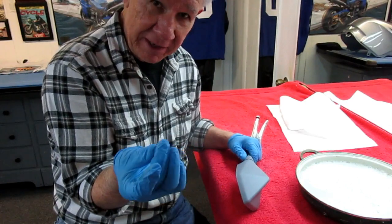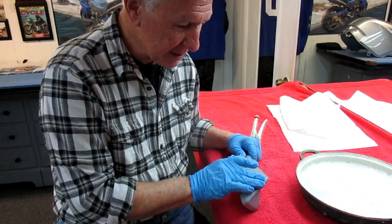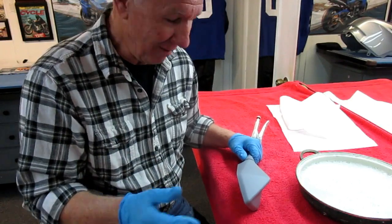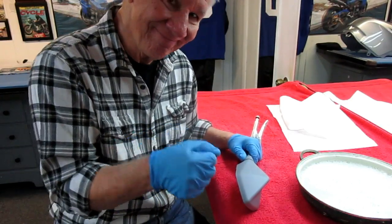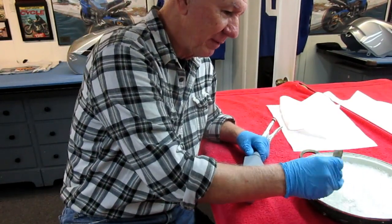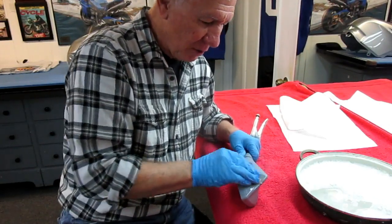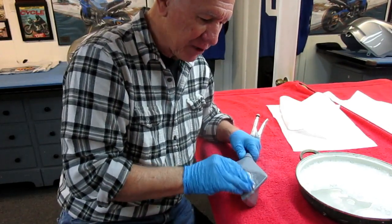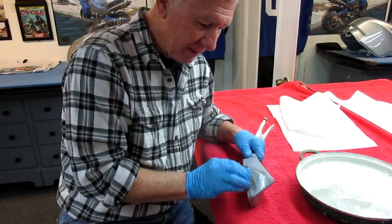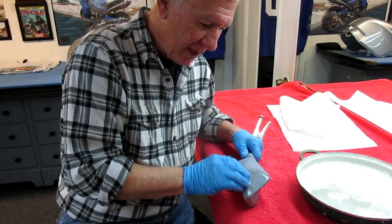If I take my hand with these very thin gloves, I can feel every little speck of dust in there. And if I paint over that without sanding it, it'll look like a modern car. I want it to look like something Chip Foose did. Anyway — the soapy water, the 400 sandpaper, pick one spot at a time. There are all kinds of theories about going in an X pattern, a Z pattern, a Y pattern — I think you just sand it and you're fine. I haven't found any real magic bullet by doing patterns. But there is a magic bullet: take your time.